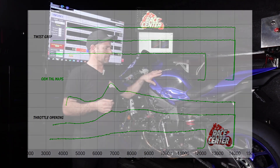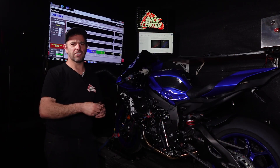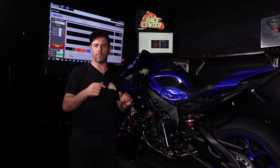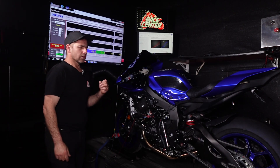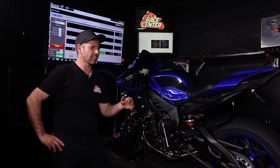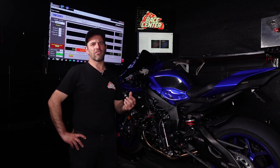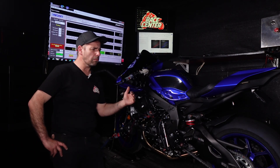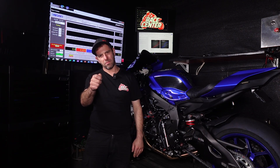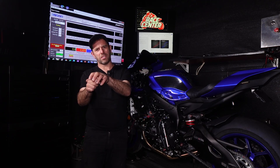The first thing we do when we remap these bikes with our NJ84 throttle maps is sort that out, so the throttles are completely linear and the only thing that changes how much they open is your hand. You can select different power modes for a different throttle response, but in any of those modes the throttle stays constant unless you move your hand. What can happen in the real world is you're coming out of a corner, picking up the throttle a little bit, and as the RPMs rise the throttle actually opens more than you expect — it's almost like someone's grabbing your hand and opening it more.